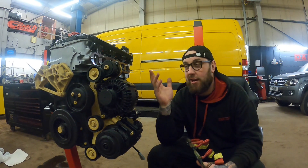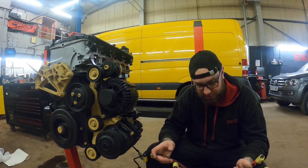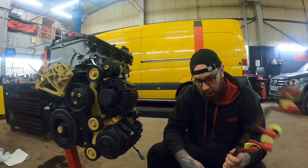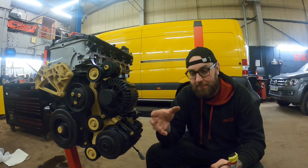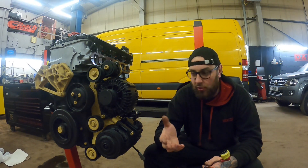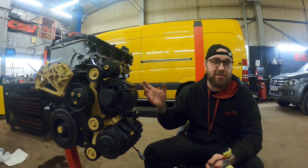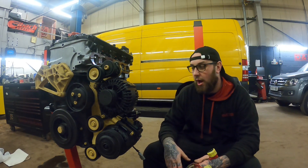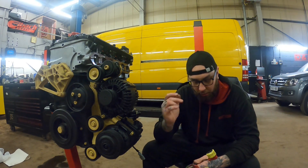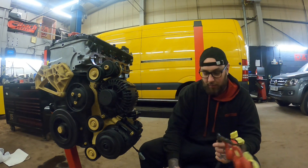I'll show you the loom situation. Because I've got different injectors, the plugs have got to be changed, and obviously the way the coil packs sit now will be different. I'm using the OEM loom because the standalone ECU I'm getting — the EMU Black — is plug and play, so I'll just plug into the normal OEM loom. However there are certain things I won't be using anymore, especially the evap and breather system, so there'll be certain plugs I don't need. I don't want to cut them off in case I ever need them, but I don't want them dangling visibly either.